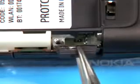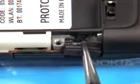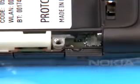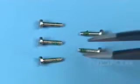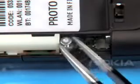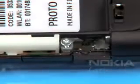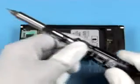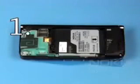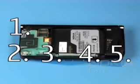Replace the camera button, and the push-to-talk button. Take these five new screws. Place them into their threads. Set the correct torque. Apply the torque to the screws in the shown order.